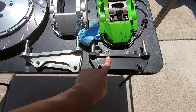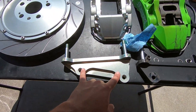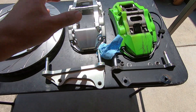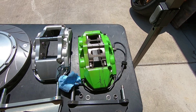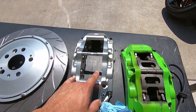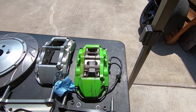Check out these brackets. With the standard street version, they come straight out and relocate like the Brembo kit on the Polestars in the same location. Whereas over here, we have a relocation kit of 12.5 degrees — so you can see how it's not only offset but also twisted or reclocked, because it's not just pulling it out, it's rotating it too, and they are compensating for that. I can see a visual difference between the super challenge and the street kit. Measuring these: 70 millimeter wall to wall versus 74 millimeter wall to wall — meaning this one is not going to be as wide. We're also going to have new stainless steel lines, which are provided in the kit.